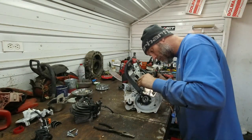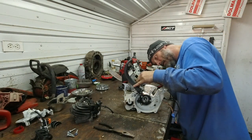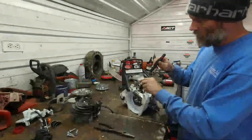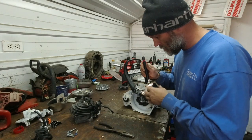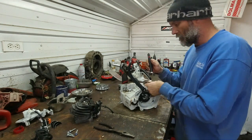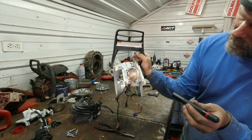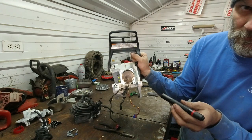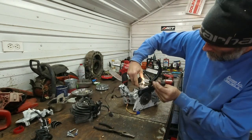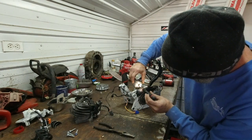We have plastic cage bearings on both sides. Slab side piston. We have one locator pin on the intake side and one locator pin for the rings on the exhaust side. Another thing to watch out for. The wash looks okay. It's not cleaning the top of the piston off perfectly, but it looks decent. And we've got two signs on that piston. Good quality stuff.